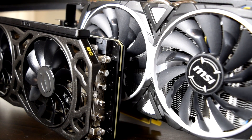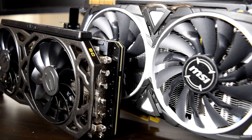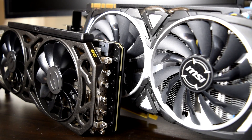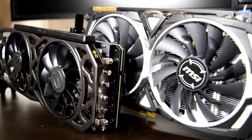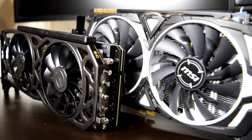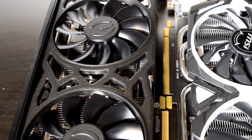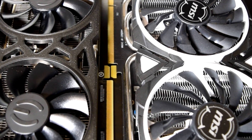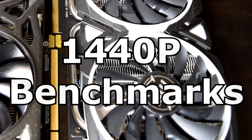In terms of overclocking, the best I could achieve with the 1080 Ti was plus 100 to the core and plus 325 to the memory. At stock clocks, the 1080 Ti was already boosting itself to around 1924 MHz, well above the advertised factory boost clock. With the overclock in place, the card was comfortably boosting to around 2050 MHz. The GTX 1070, on the other hand, had plus 200 to the core and plus 400 to the memory, allowing it to boost to around 2100 MHz. So now let's jump into the benchmarks and look at the results.